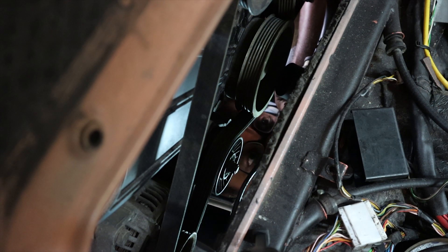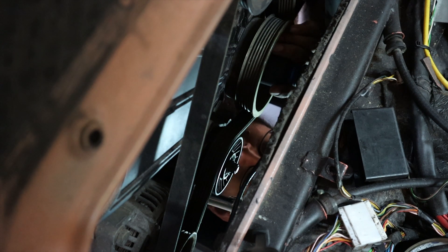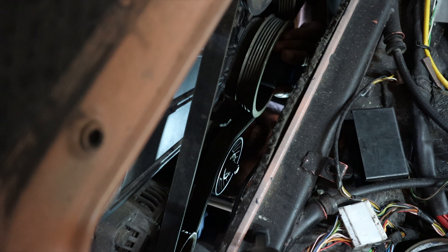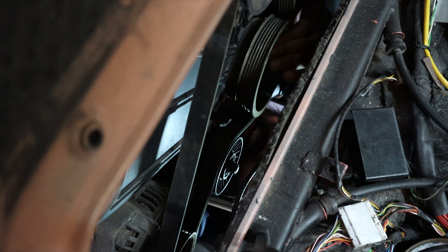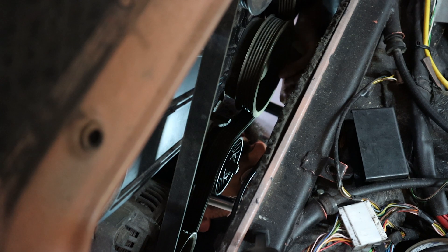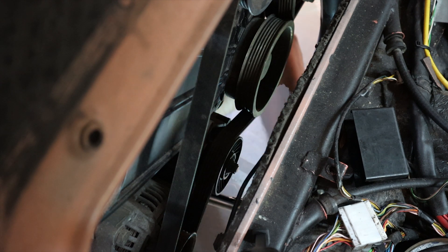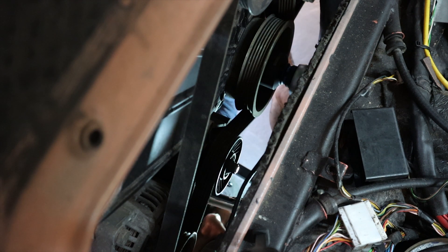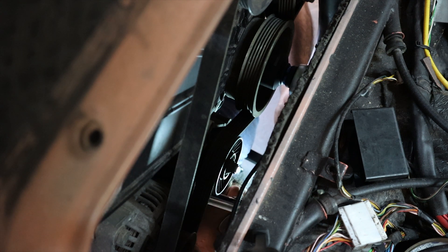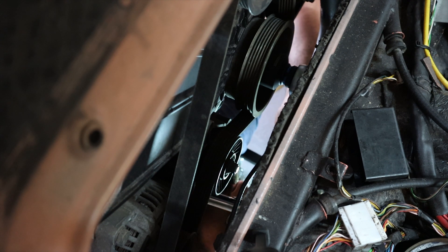I'm underneath as you can see, and I've got this socket attached to a big breaker bar. Given the space restraints I'm trying to get this hooked on and then hopefully we can try and turn the engine by hand. I think it might actually be easier to try it with the other bar first, see if it moves at all. Girt's hooked on to the main crank with the 36 millimeter socket. We might need to lift the car up further actually, because I've only managed to get a small bar on here — but we'll give it a go.